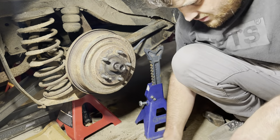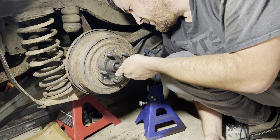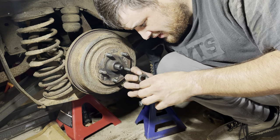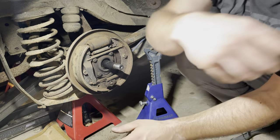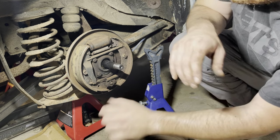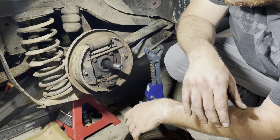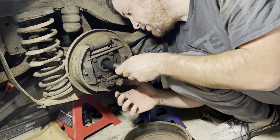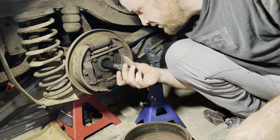On the other side I kind of messed up the threads in the nut just from the threaded bar, but honestly that's fine. They're a little screwed here too - I'll either get a new nut. Oh, I didn't break anything - sick. It actually looks like these wheel cylinders are relatively new on both sides, but I'm still going to replace them because I only want to do this once and I want to know it's done. I'm going to run this on backwards and use the stub axle to chase the threads out of the nut, or I'll just run the impact in reverse and whip it off.